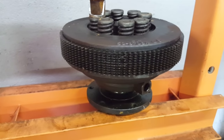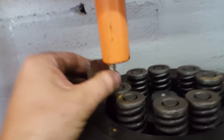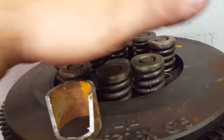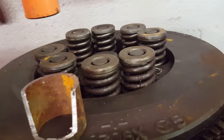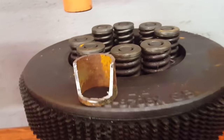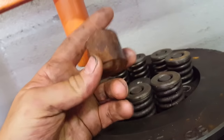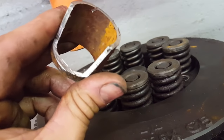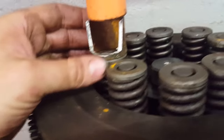I took that release arm or throwout bearing arm off. Now I need to take these keepers out. They make a special tool for these — it's got a plate with eight holes and two holes for bolts, so you can do all eight at once — but the plate's a couple hundred dollars and I don't have one. So I took a piece of one-inch pipe and just cut a little edge off of it with the bandsaw. You could do that with an angle grinder or hacksaw or anything, then stick it in here like this.